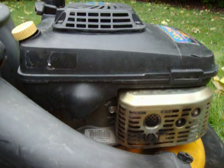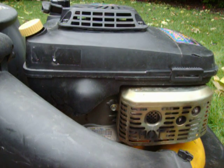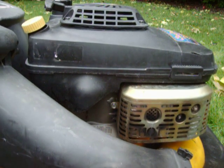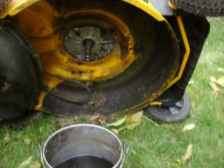This motor oil wasn't the dirtiest — it was starting to get brown. I picked this lawn mower up in a trade and the guy said he had it for about two or three years. It was clean oil, but when oil sits for a long period of time, even not being used, it'll still lose its lubrication like it's being used. So if you have a lawn mower that sat in storage for four or five years and you just put brand new oil in before storage, change it anyways. But still change it before you put it into storage because it helps keep the engine alive.